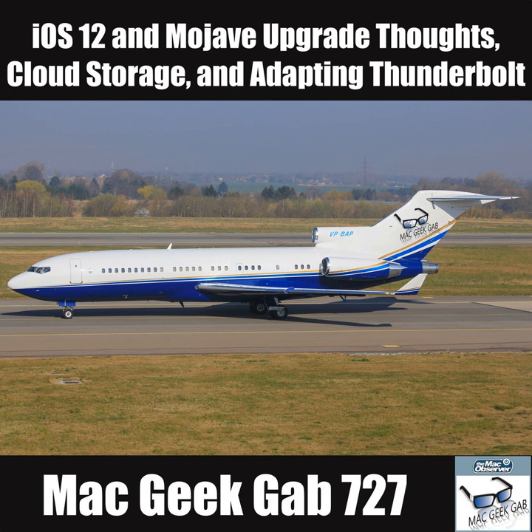As you know, we have NAS devices. My Drobo, which has five drive bays — it's the older FS, but it's still cranking. I started getting messages from it saying something's wrong, I'm fixing it. And when you keep getting that message, at least with this Drobo and most Drobos, that usually indicates a drive is on the way out. Sure enough, it kept happening more often, and all of a sudden I got a red light on one of the drive bays. That means it hates this drive and will never use it again.